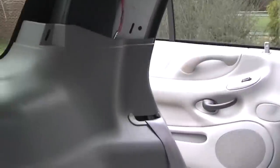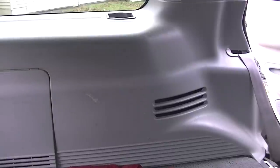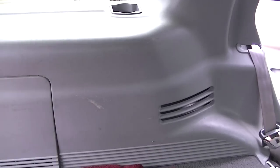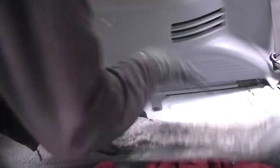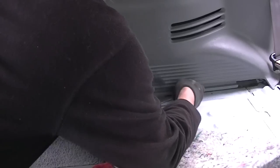As you can see, the pan down here — that piece there kind of gets in the way of the piece we have to take off. Let's go ahead and pull this panel off, pull it back like this. You may have to lift up on it — it's a pretty big piece. On the bottom here, there's a little plastic tab to pull this off that's hidden over the carpet. Sometimes you have to get down here and make sure you get that off — a lot of times that will get you hung up. So just get a screwdriver and pop it off. Now we can go ahead and pull this out and just push it out of the way for now and lay it down.